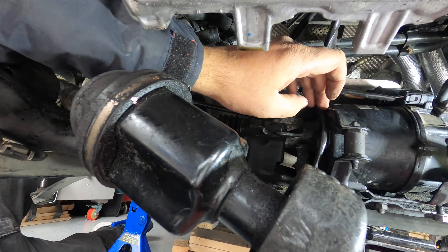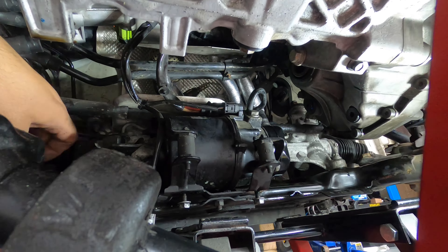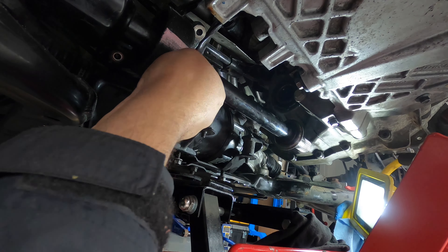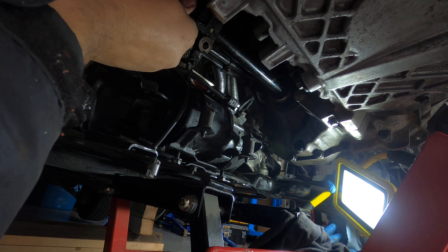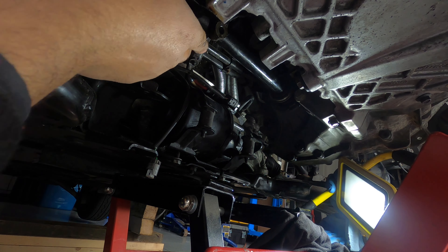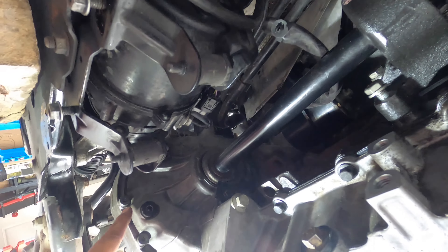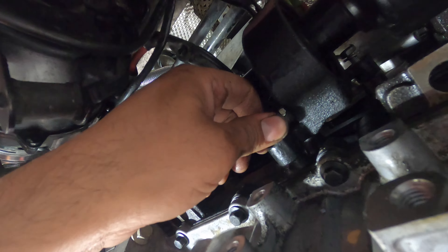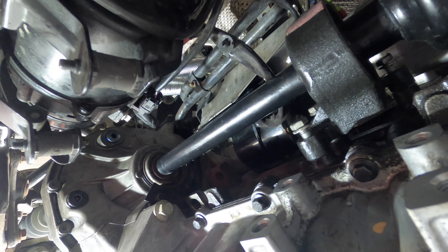That connector is for the power steering cooling fan. Now while we're at it, we're going to put the driveshaft in too. Turn the shaft to get the alignment right. You've got to make sure the carrier bearings are actually placed in the right spot. Now we've got the driveshafts lined up — both of them in the gearbox. We're going to start filling up the transmission now. Before we do that, I'm going to start tightening the carrier bearing bolts, and then we'll pull up the subframe.